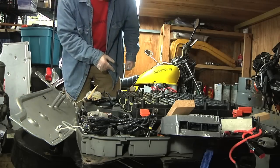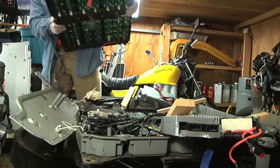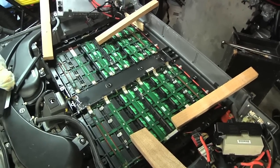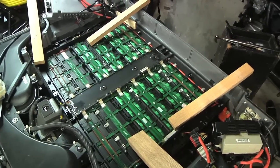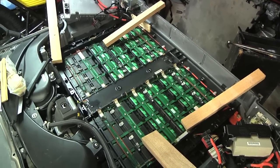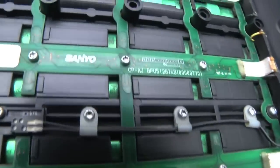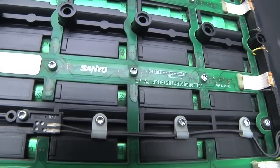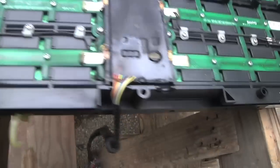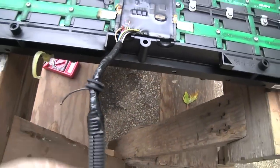Okay, second try — power terminals away from me, everything's unplugged, lift with legs not the back. Now we have a good view of the bottom layer, the inside of the pack. Let's get a close-up of the top half I just took out. So here's the top half of the battery pack. These are Sanyo nickel cells. There's kind of a grid of circuit boards here that would be the BMS connections, and that all goes to the middle to a potted area, and then connects down through a multi-pin output cable — that would have been going to a box with BMS information.